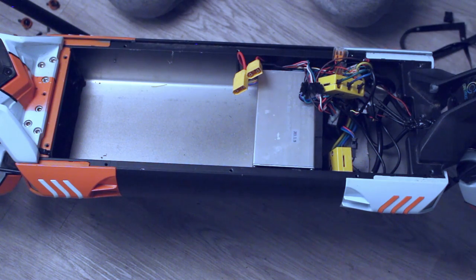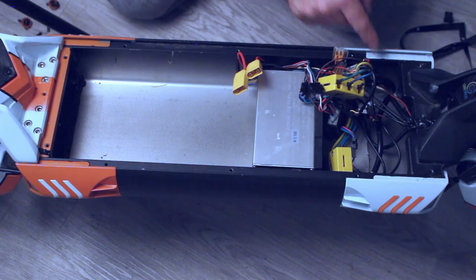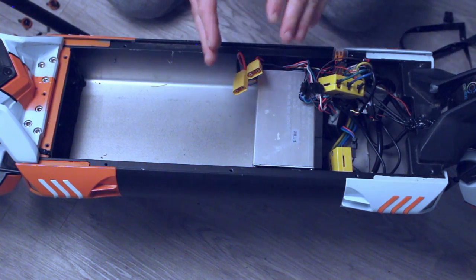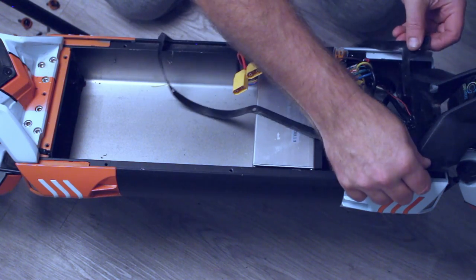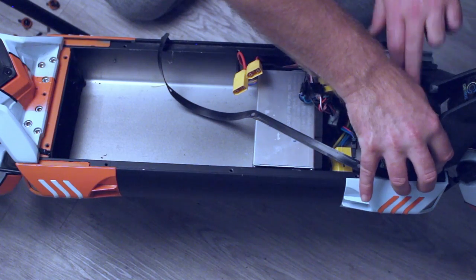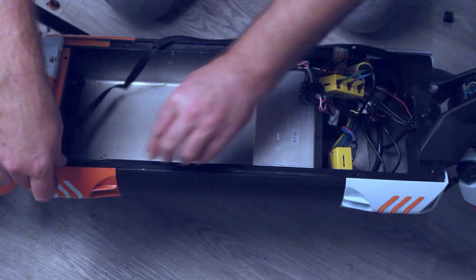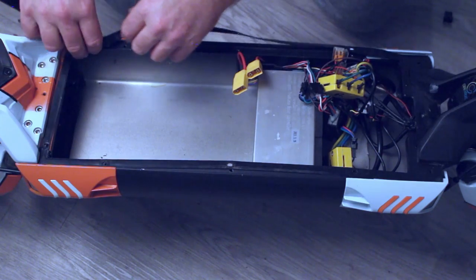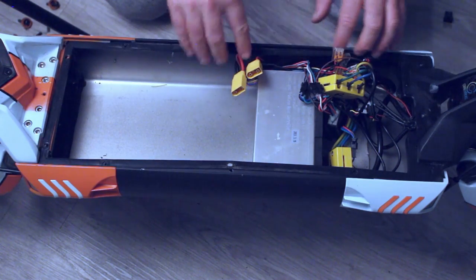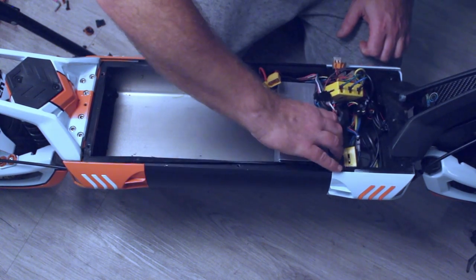That's how I would seal this up. I'm going to get a bit of cloth and gently massage that into the three holes here, then let that dry and cure. Probably the best thing to do before going any further is to get your rubber seal and lay that down so any mastic doesn't prevent it from sitting flush. We put mastic in two of the entry exits right here and at the nose. Then we slide the controller gently forwards.